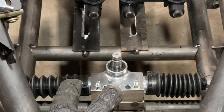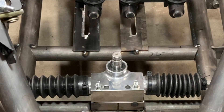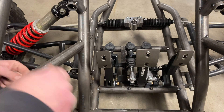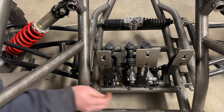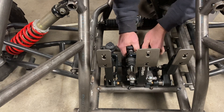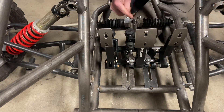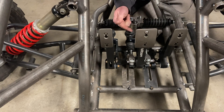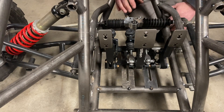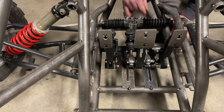And there you have it — tacks in the front. You can go ahead and add some more tack welds if you want, but this is going to hold because there's really no stress on this. Now, take your wavy washer and your serrated nut and put it on the underside. Just barely hand tight — this is pretty solid already. The point of the wavy washers is so you don't have to get a wrench underneath to loosen these up. You can do it all from the top with an Allen wrench. As long as you don't loosen them too much — just enough to slide — the wavy washers will lock the nut back in, so you have all your adjustment from the top.